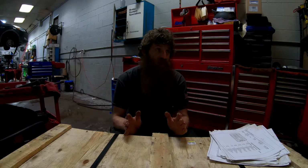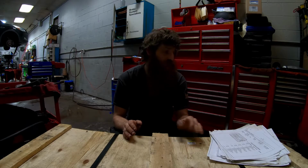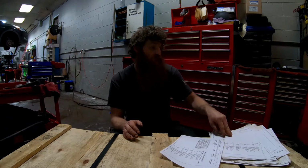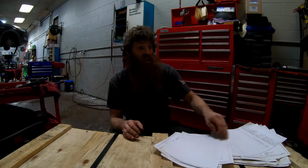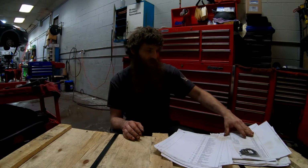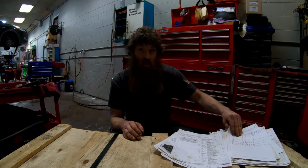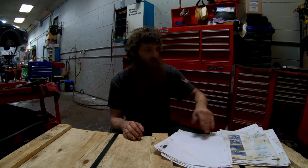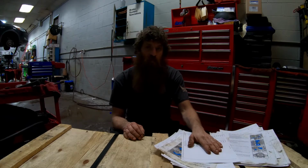So originally when the truck got here, it had multiple codes. I'm talking like 13 or 15 codes in it. And it all started with the IAT P0113. And then there was a P06A7. That's the VREF code, which caused wastegate pressure codes, turbo boost pressure codes, and the IAT was reading -40 all the time, like it was open, which it was open. But I repaired all the wires and it's better now, so hopefully this helps you guys.